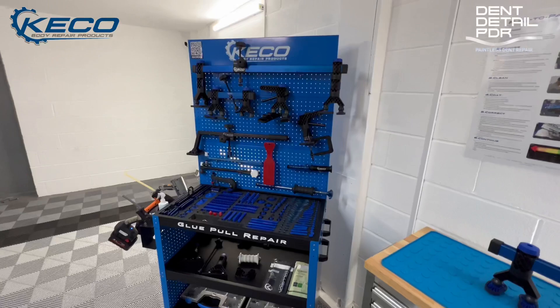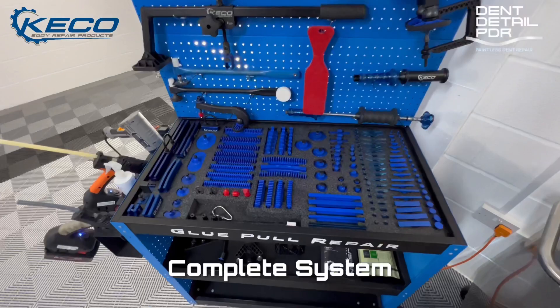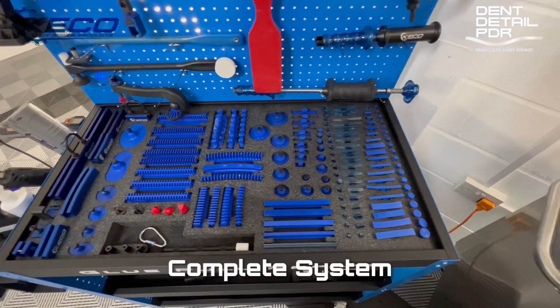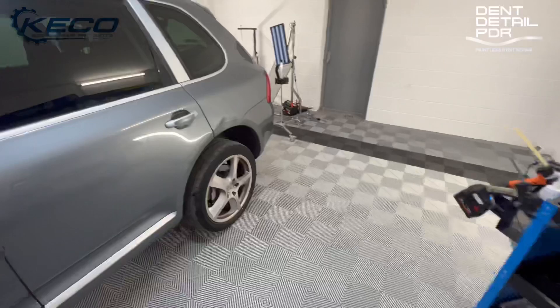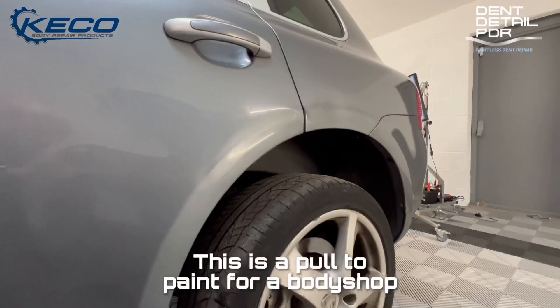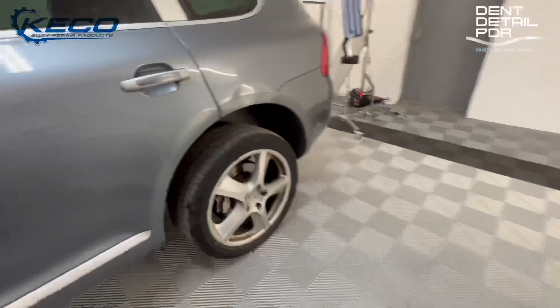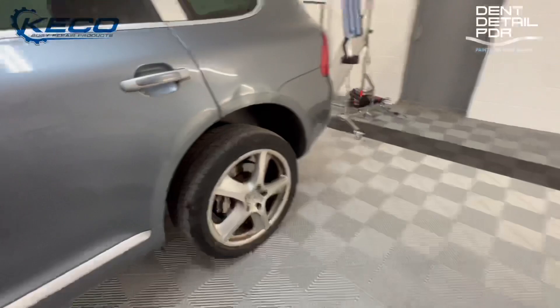So all in all, I think the Level 2E is a really good upgrade on the older system, which was great — but it's just been massively improved. It's all about efficiency — everything is easily laid out from the biggest stuff down to medium size, down to smaller stuff. It's great for body shops. This job here going to a body shop for paint work — everything I need to tackle that dent is on that system. It's big damage right on the arch on both arches, so I'll be using the K beam to pull most of that out, the C hook to straighten that edge out, and then working my way down to some of the finer dents using the finer tabs. I'll take a few shots of the repair and show you which tools we used on it. Thanks for watching.